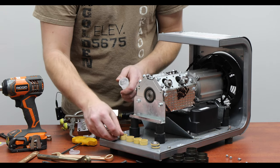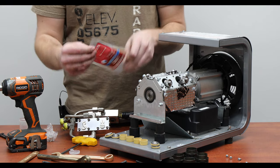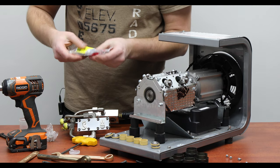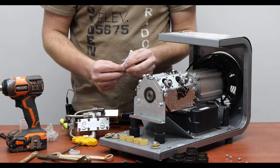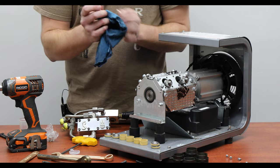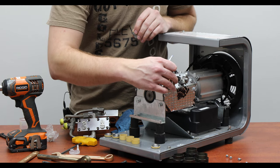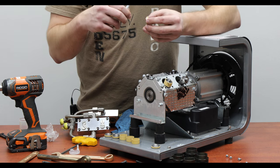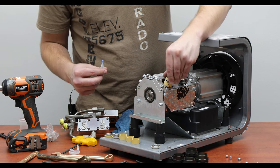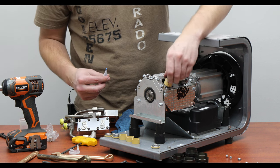I'm going to open these all up and start putting new pieces in and put it back together. The last thing I'm going to need is just a small tube of Loctite — our SKU number is BVV-SUP1. It's a single-use tube of 242 Loctite, and I'm just going to put one small dab on each piston as I put it together. Just twist off the top of that Loctite cap and it is ready to use. Just one small dab per piston — put it inside the threads of the piston. As you screw it on, the Loctite is going to smear around all inside the threads, so no need to put too much on there.